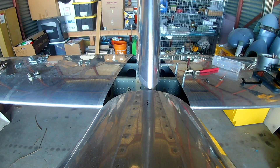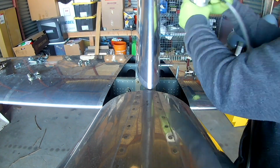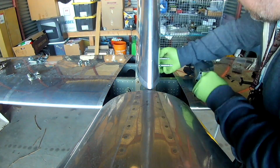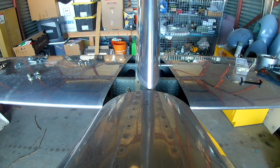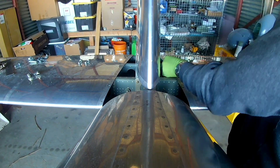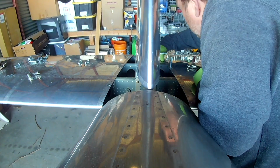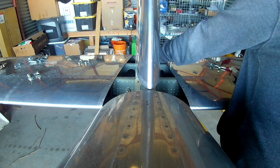The problem is these fittings need to point down, so you can't just torque them until properly torqued because you don't know which direction they might face. The way they combat that is with a collar fitting that goes on the AN fitting going into the housing, which is supposed to stop oil from leaking. There's actually a much larger AN8 collar fitting that goes over the AN half into the housing and has a rubber seal — you tighten that up to keep oil from leaking out. That's one of the common leak points.